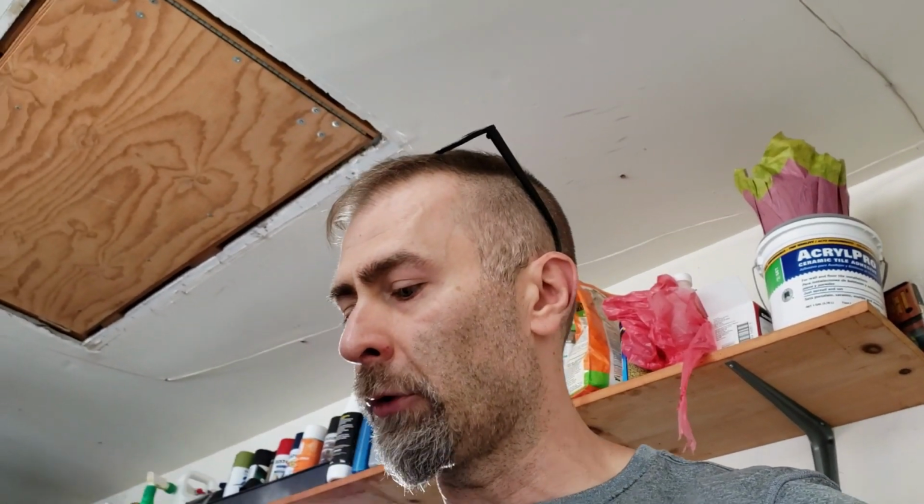I'm going to evacuate all this stuff out. I'm going to start with the high side, evacuate the liquid side. I'll get that down close to zero, and then once it gets pretty low, I'm going to turn on the vapor side and start vacuuming that out. Then I'll be able to close the system off and get underneath it and try and pull that little valve out of the compressor, which I'll show you later.